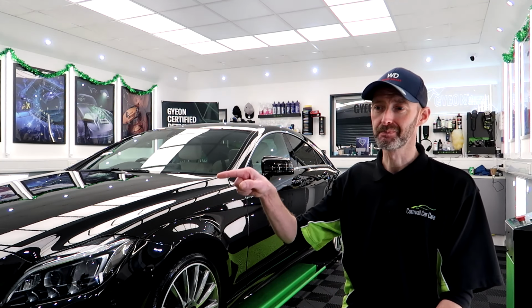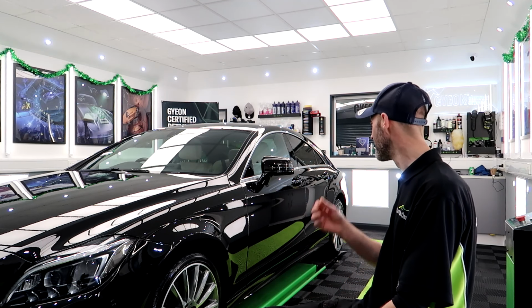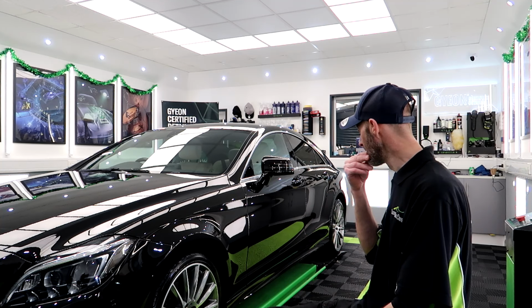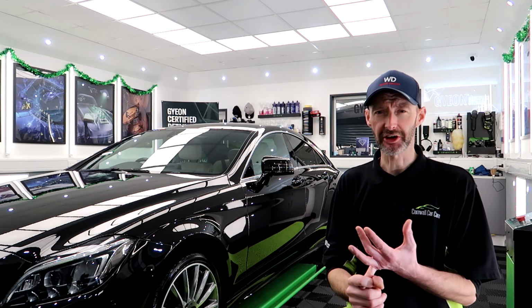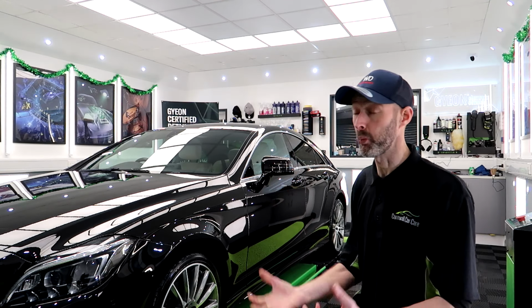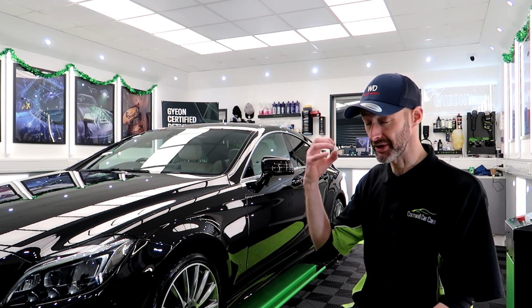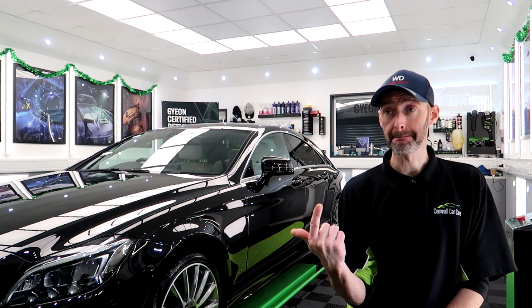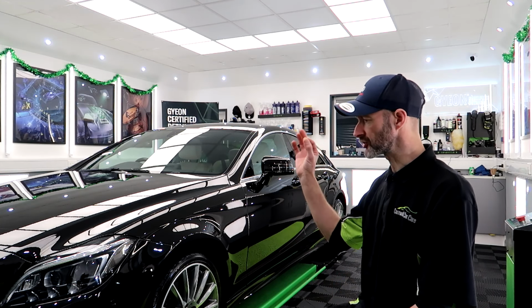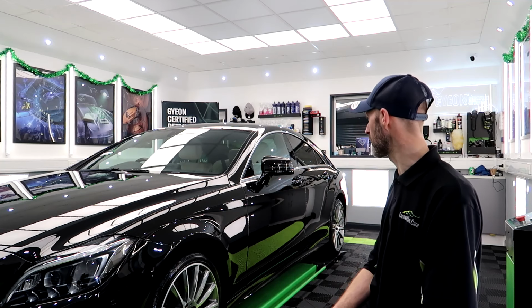I was just looking at the photos of what this looked like before and comparing the before and after. That's a truly epic transformation. This had a minor correction detail, multi-stage machine polish to get the paintwork to 80% defect free where I can. We went past 80%, the paintwork responded so well. I think this was Meguiar's microfiber cutting pad, Gyeon polish pad and Gyeon polish for the refinement stage. Some paints respond really well and some are a bit finicky to work with, but this was an absolute dream to work.